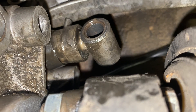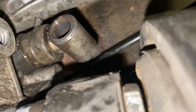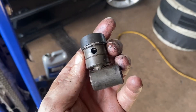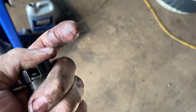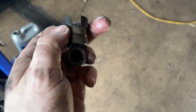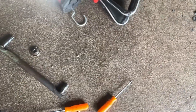So the pin on this one actually goes up. I'm not sure if I can get the clip out of the way enough to make it go down. I am going to try that next because there isn't quite enough space, even with the trans mount dropped. But you can get a good idea of what I'm talking about now. When I put it back on, I'm actually going to move the circlip forward because it's a little easier to deal with it that direction. The key to getting this off is really just working your pick under the top and forcing it forward. You can either push this little pin up or down. The later cars, the pin goes through sideways, not top to bottom. Anyway, that's out.